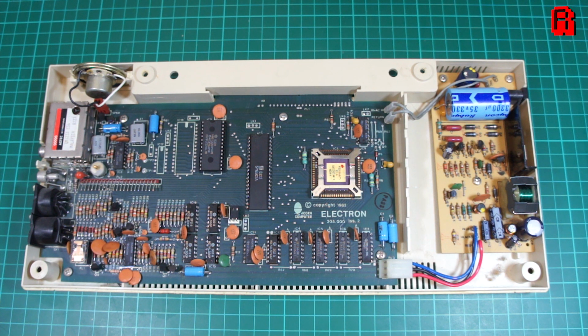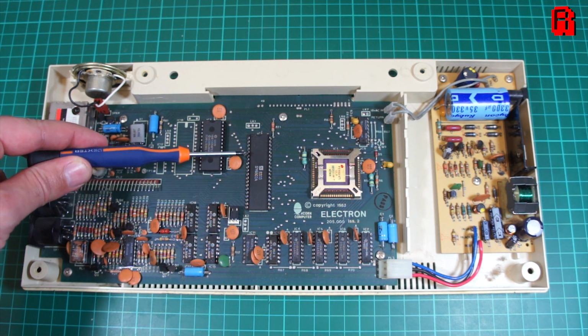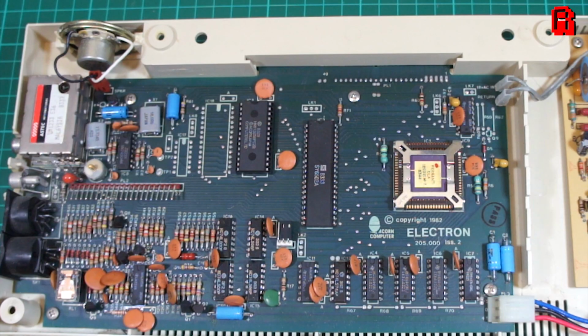The CPU is a MOS Technologies 6502 running at 2 MHz. It too was affected by the decisions made in the memory addressing. With the 4-bit wide memory bus, it required 2 accesses from the CPU to retrieve an 8-bit word. An 8-bit CPU which can only access RAM 4 bits at a time is obviously not running to its full potential. The CPU can access ROM at the full 2 MHz, but RAM at 1 MHz to enable it to share access to memory with the ULA.